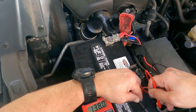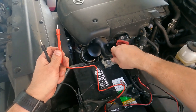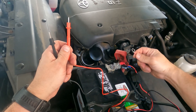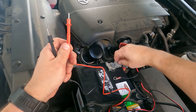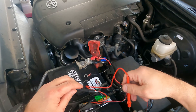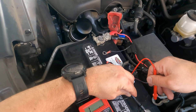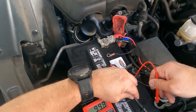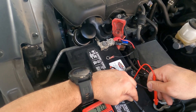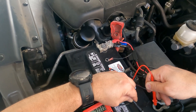Unless I disconnect the camper shell entirely — let me go ahead and disconnect the camper shell wire and reconnect the rest. Now measuring from here to here — the computer will reboot again but once it stabilizes it'll go back down to about 27–28 milliamps. Just have to give it a couple seconds. Yep, there it is — 27–28–30 milliamps and it just stays there.